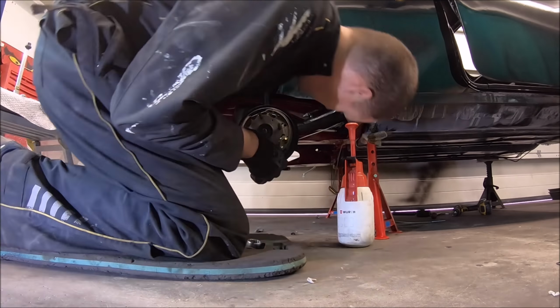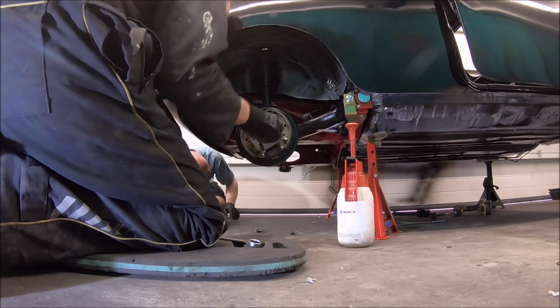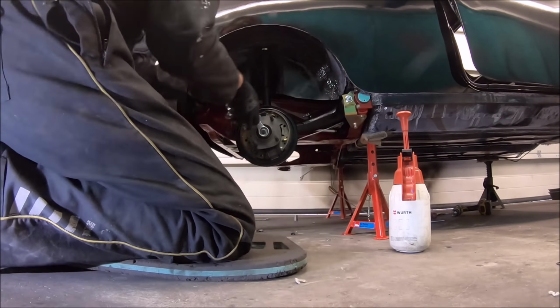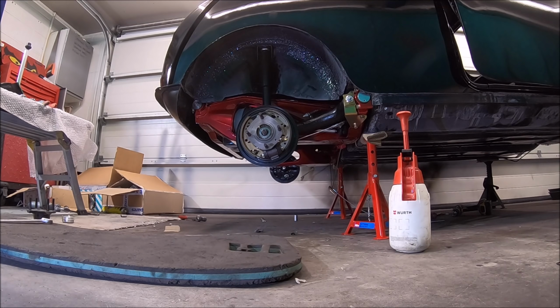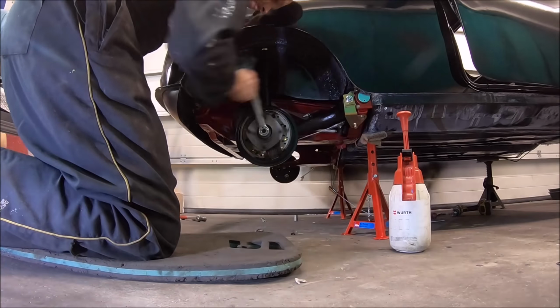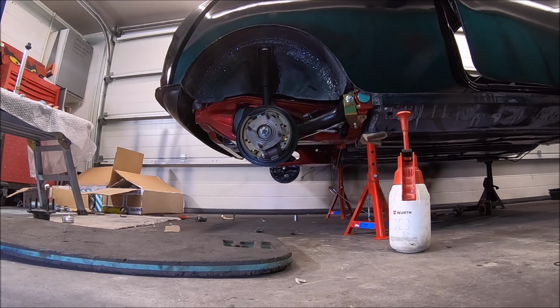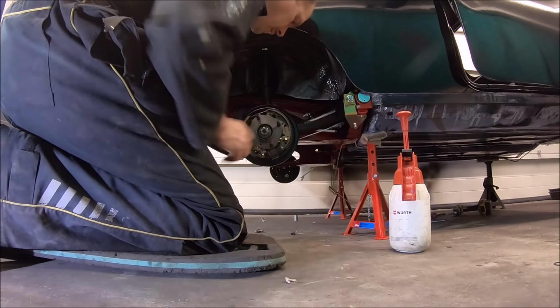I remember a friend telling me he'd fitted stainless steel nuts and bolts on his Harley Davidson. It was a regular job going round them all and retightening them all back up again. Whereas you didn't get that with mild steel, just because it has a bit of stretch. I don't know what you call it, a bit of elasticity or something like that, but when you tighten up a mild steel bolt, it stays tight. A stainless steel one doesn't, so that's why generally they need to either have a lock washer on them or be nylock nuts.